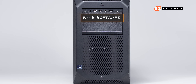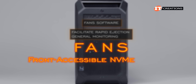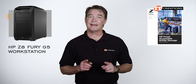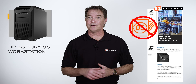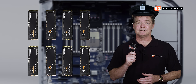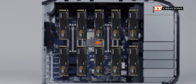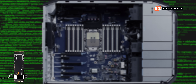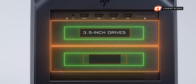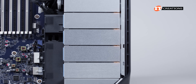These drive bays also have their own FANS software — a separate software utility to facilitate rapid ejection and general monitoring of the drives. FANS is an acronym for Front Accessible NVMe Storage and comes pre-installed on the system. The full story on M.2 storage is found in the HP Front Accessible NVMe Storage Technical Guide. Given those drives are removable, it is not recommended to load the OS on them. I'm only counting eight M.2 slots and did look a few times, so let's assume another dual Z-Turbo card in one of the PCI slots — if one of you figures out where those other two M.2 drives are installed without using a main PCI slot, post it in the comments below. For 3.5-inch drives, two can go in the media bays up front connecting via SlimSAS to the motherboard, and four more internal 3.5-inch bays are in the lower right portion of the chassis with direct connect slots.